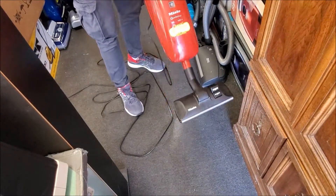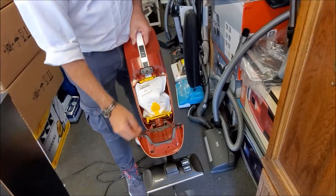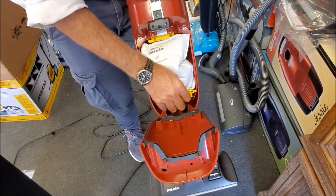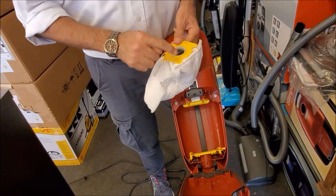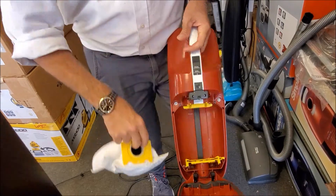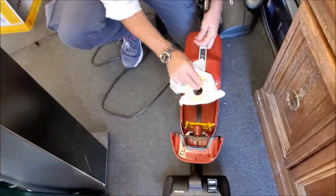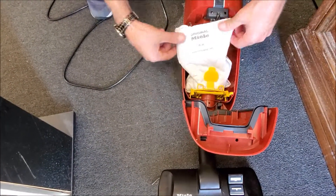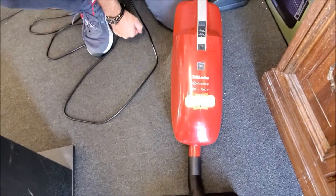To change the bag, press the button for the hood and open the door. Hold the bag by the yellow latches, lift it up — the bag comes off. There are two arrows; match these two arrows over here and it can be snapped just like that. Slide it in like a drawer, all the way in, and it will automatically close itself. Done.